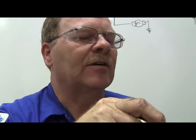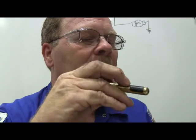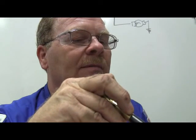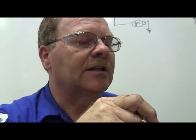Minimum standards for brake fluid set by the U.S. Department of Transportation is DOT 3, DOT 4, DOT 5. Yeah, well, the minimum standard is DOT 3, right? Okay. Some wheel cylinders and calipers can be honed to remove minor surface flaws. Well, that's true. Minor surface flaws is the key phrase there.